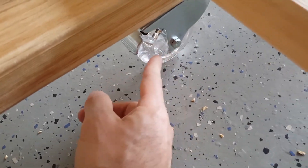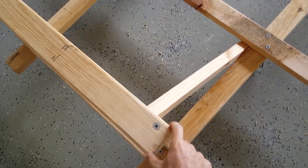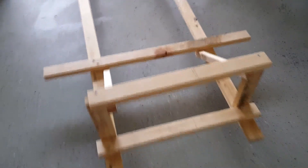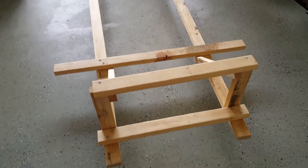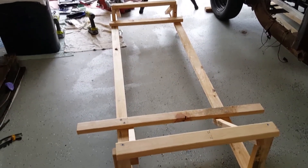What I've done on the underside — just from the local hardware store — these casters are rated for 100 kilograms each, so plenty of cope, and each one has got a brake so I'll be able to move the thing around the garage and away for sandblasting. It was difficult to exactly measure but I've got a little bit of tolerance here, and these boards are untreated pine. I'll maybe post the measurements if anyone's particularly interested, and some 65mm timber batten screws. It is pretty solid — I can jump up and down on it. I'm about 70 kilograms so hopefully it sits nicely on there.